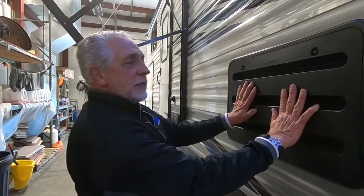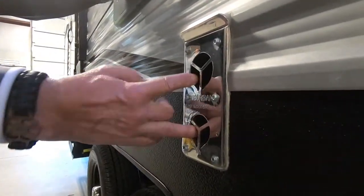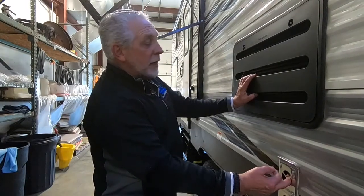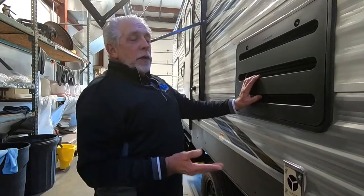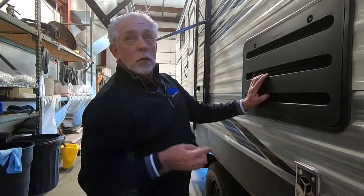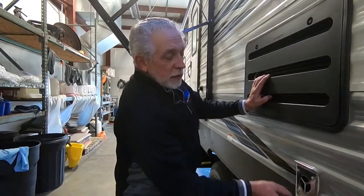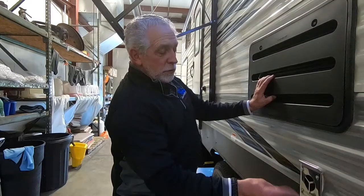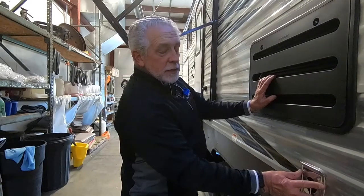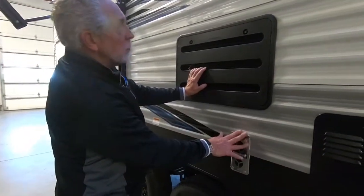This is the back access to the back of your refrigerator. This is your furnace outlet. It runs on propane, and there are some bugs and insects that are addicted to sniffing propane — they will get in there, build nests, and screw up the operation of your furnace. Get one of those screens that covers your furnace exhaust. It keeps bugs from getting in there in the first place, and it also keeps anybody from accidentally bumping against that furnace exhaust and getting burnt, because when it's running it will get hot enough to leave a mark.